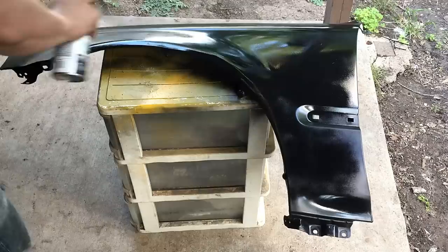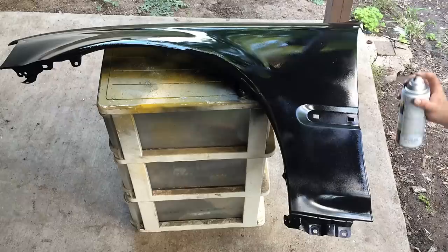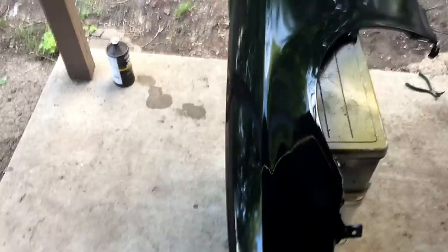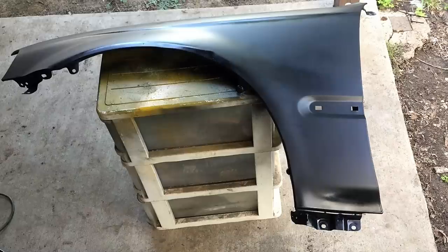Basically you're just gonna coat it. If there are little areas still showing through where you can see the fender, just make sure to cover them — it doesn't have to be super thick, just cover it. Make sure not to paint in direct sunlight on a super hot day or with the wind blowing. The wind takes the paint and doesn't allow it to actually get onto the project. If you can't avoid it, try putting up a tarp where you still have visibility. This is basically what it'll look like on the first coat — kind of hazy, not absolutely perfect. Let it dry a bit; we're gonna definitely have to let it dry more.